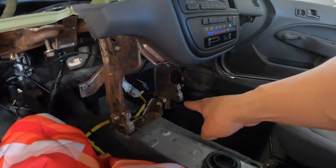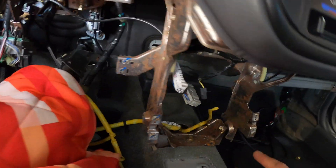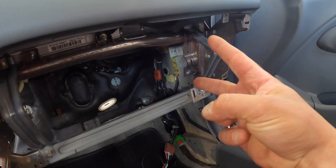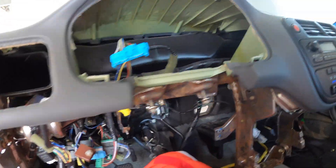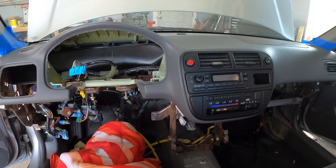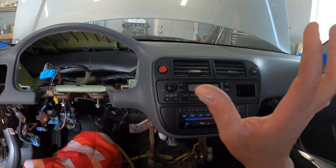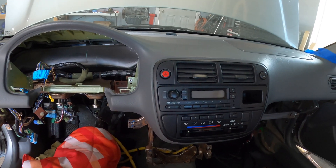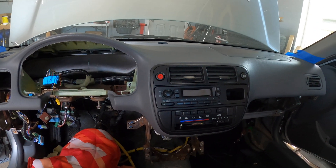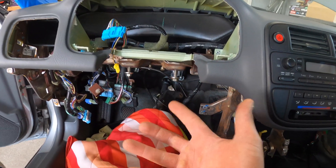It's just sitting in place with one bolt for now. Going over the bolts: two up top, one down here, two lower ones, two side ones, and then that 10-millimeter up there — those are all the bolts that hold the dash into place. It kind of just sits into place. I started with it tilted back toward me, got the feet on the ground, then rolled it and sat it in. You can tell it's where it needs to be. Getting these tightened up now.